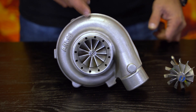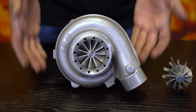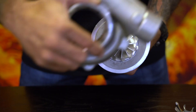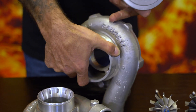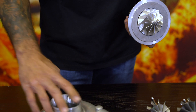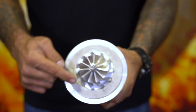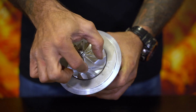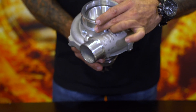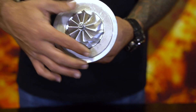This is the Chinese magic trick we played with earlier. I want to show you more detail so you guys can get an idea of where the copiers are going. This turbocharger is non-genuine. Obviously it doesn't say Garrett on it — if it said Garrett cast on the actual housing, it would be counterfeit, illegal. The Chinese are well aware of what counterfeiting is and they don't do it, so they make a copy but remove the actual name. If you look at the wheel, you'd say oh, that's a GTX Gen 1 — count the blades: 11 blades. GTX bullets Gen 1, 3071R? No, it's not. It might fit inside a Gen 1 GTX 3071R compressor housing, but this compressor wheel is non-genuine.